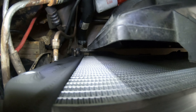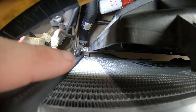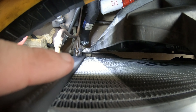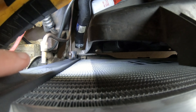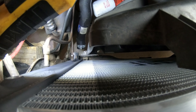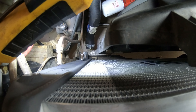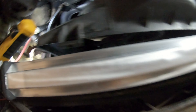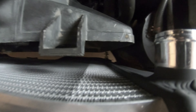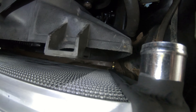All right, as you can see that bottom isolator right there needs to be moved out just a tad to get it in line. From what I've read, all you have to do is pull the isolator out, trim off the little locator nubs on the bottom, and then move it over to fit — that should take care of that issue. On this other side it lined up just right, no issues, so it should just be the one. We'll go ahead and give that a try.